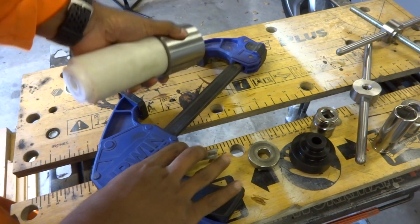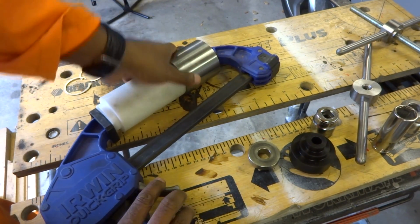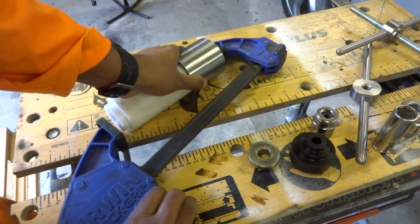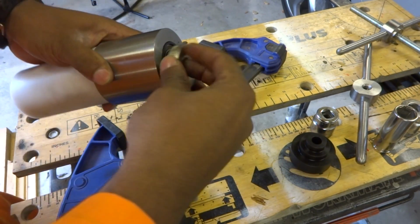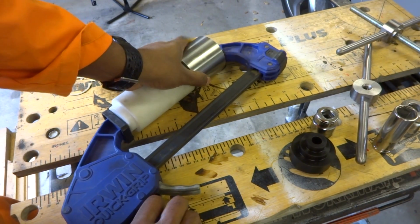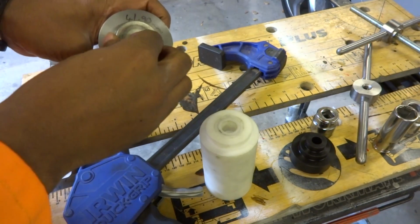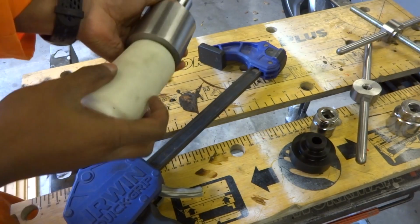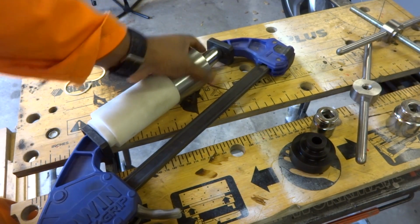So slide this over the end of the bottom bracket, and then, no, it's not quite enough, till it's flush with the end, and it's halfway out. Then we can install the Park Tool or a socket, continue to press, and now it's semi out. Okay, drop the tool in there, and then we just need a socket just to bridge the gap. Continue to clamp.